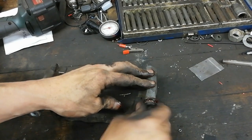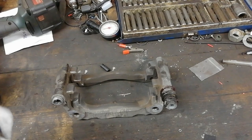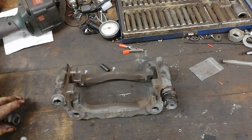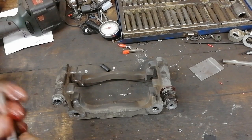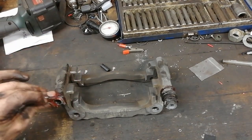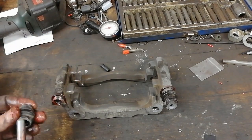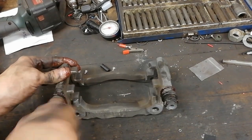And similarly here, and we'll do the other one. So 2 minutes does this, 2 minutes, and you know that the thing's going to be right. And even though they were free there, we still re-grease them, because a lot of people just see, oh, they're free and they're dead on, we'll just leave it the way it is. So a wee bit of grease in there. Not too much. Don't need a plaster. So less is more.